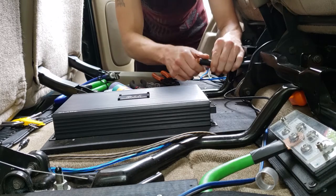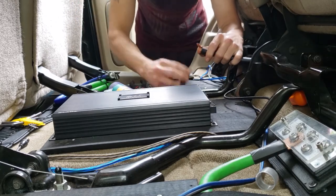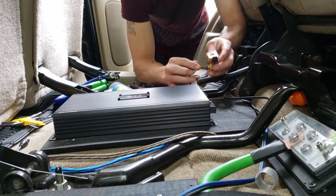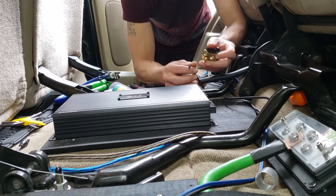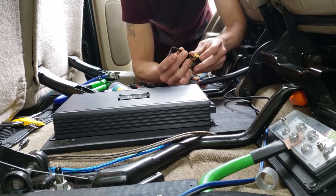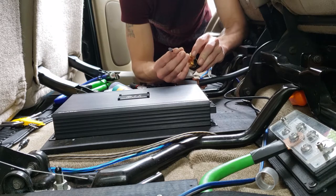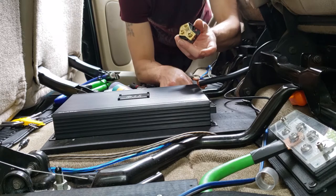I had it before, guys. I just had it bent back out of the way because it's supposed to be a 0-gauge reducer. So it's supposed to be 0-gauge to 4-gauge reducer, but the company didn't count on people having true OFC wiring, so it definitely wasn't. So I still had to kind of modify the wire, but it works when you do it that way, so it's just not ideal. But this little distribution block was only $4 too.